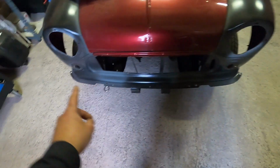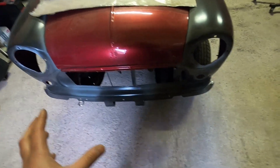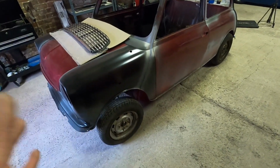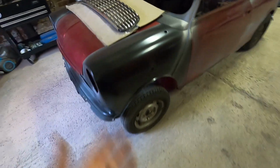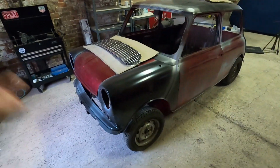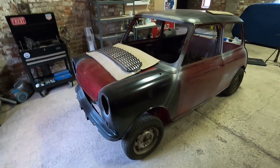Put them on like that, put the bumper on, and then we'll line the grill off, and then the front's kind of dry built. And then I think in the next episode, we'll get the wheel arches on, and then the whole package, everything that needs to be fitted to the car, is bolted to it. Because things like indicators and aerials are already pre-drilled. That's why you buy good panels, because all that's done for you. And we've deleted the holes along the front panel, like I said already. So that's done. Nothing else apart from the arches needs to be drilled on it. So let's get you on time-lapse again, and let's get the front bumper on and the grille fitted.